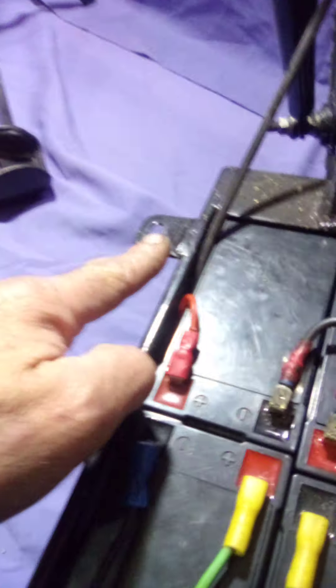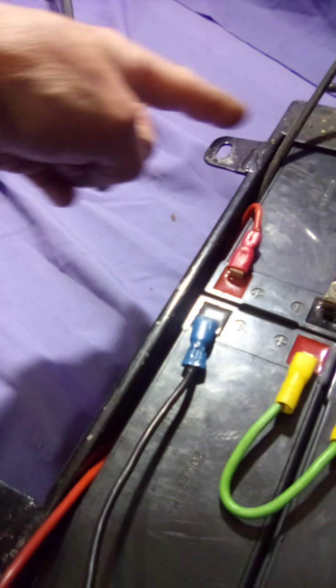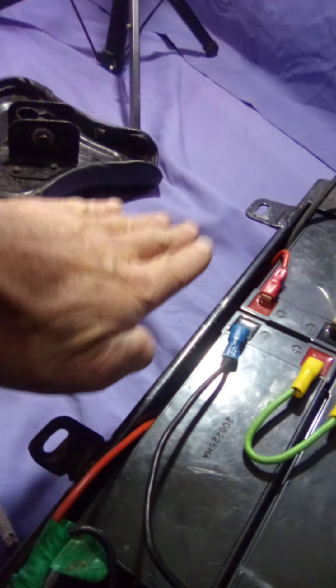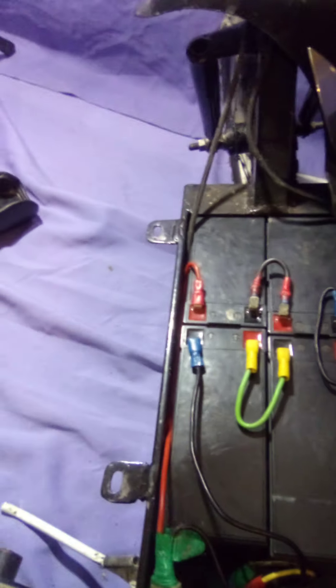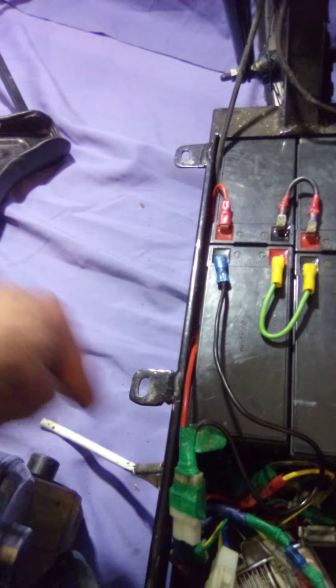Another thing I've come across, guys, is the plastic here. As my boy was standing on here, the bolting positions here and here are here and here. That's only really tags sticking out. I was thinking of building another plate that came out, so when he stood on these sideboards it just wasn't standing on nothing. That's why his scooter keeps breaking — because when he's standing on it and he's getting bigger now, it's really just standing on the strength of the plastic. So I will look into that and rebuild some cool structure pieces coming off each side, and take the tabs off and put holes in the new plate work that I'll put in.